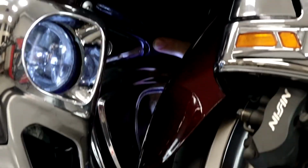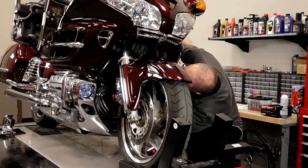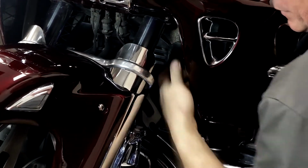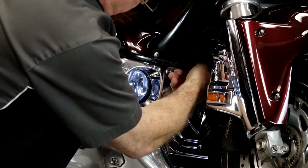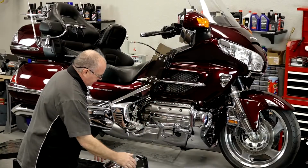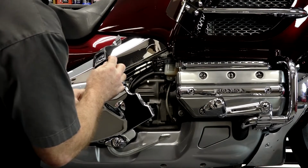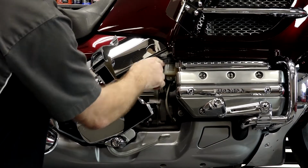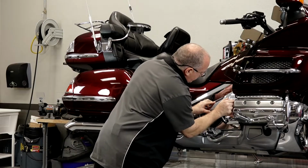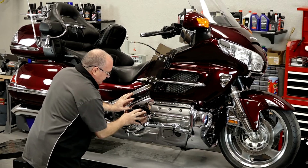All right, we're about to go dead center here and here with the plastic rivets, and then the other set of rivets go all the way up. So you have to get it inserted all the way, then lock it. Now we just need to do the other side. And now it's locked. All right, make sure your dipstick tube is tightened down, and now there's only one more panel to put back on. Now you'll notice, of course, this little section right here needs to line up with that. So what you need to do is go in a little bit of an angle, get it to push on there, got it down, and now push it in. And that's it.